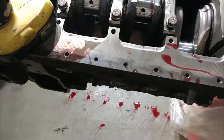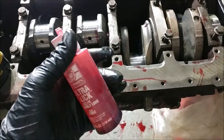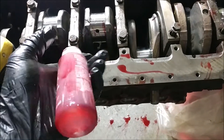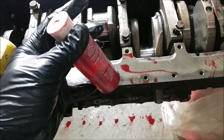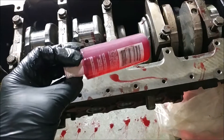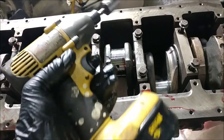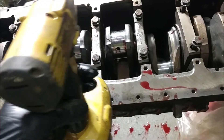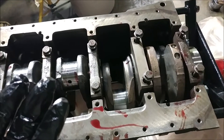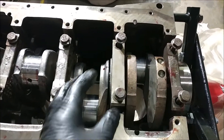If you notice, this thing looks fairly clean, and if you just pulled it out of the store it probably is. But I went ahead and took some brake cleaner and wiped down the outside of it. Why? Because I don't want any crap getting on my hands or falling into the motor. Likewise, I cleaned this guy up — with a rag, some compressed air, whatever you have — so that nothing's dropping off into the motor. It sounds crazy, but surgical cleanliness is what we're shooting for here.